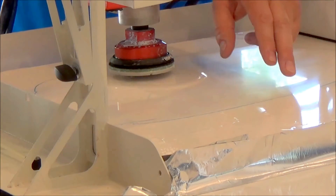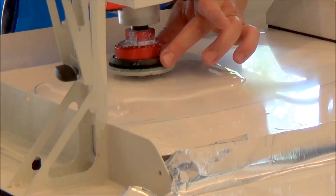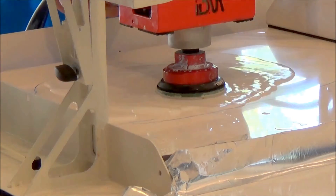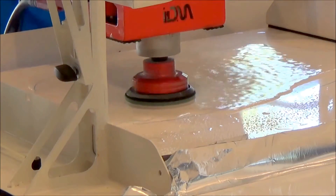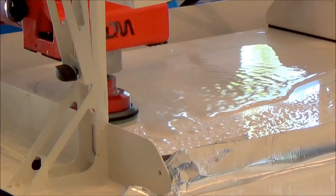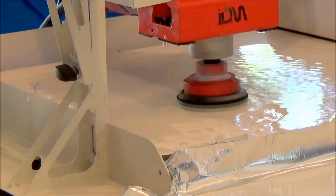Now that I've finished with my 500 level, I've carefully marked off the outside perimeter of my polishing area, and now I'm moving up to a 1000 NSI pad. Again, using the snail lock, I can just change this without removing the polisher. I've finished my 1000 grit — I did two passes, just like I did with 500, to get it as even as I could and get some of the corn rowing out.